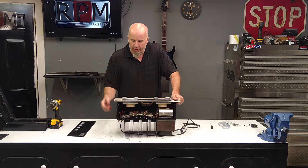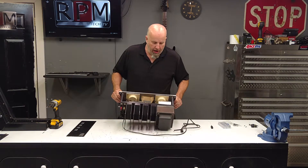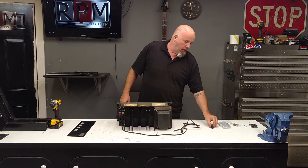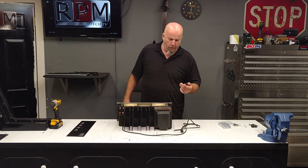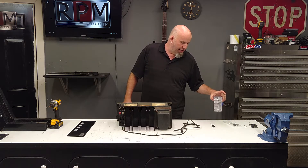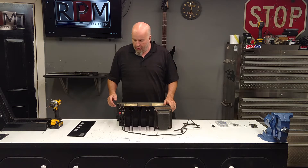So what I'm going to do is take this thing apart, get the soldering iron in there, and take those old fuse holders out — remove the makeshift fuses — and install some of these right here. They were only about three bucks a piece, but they look like decent quality, and we're going to put those in the panels. We've got some actual glass-type fuses that we're going to mount in there.